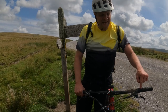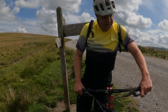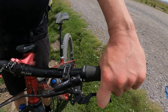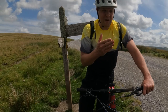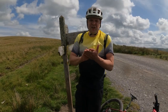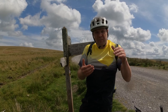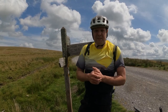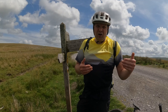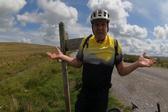Just to compare: my friend Sally's bike runs Shimano Deore XT — a really popular brake that loads of people love. It has loads of free stroke, you can wrap one finger around the lever, and a very definite bite point, but the modulation is very short, so once you're on the brake you need to be quite fine in control. In contrast, SRAM brakes tend not to have such a definitive bite point — some people call it a soggy bite point — but loads of modulation; you can pull the lever right to the bar. On the other side, Hope brakes don't have much free stroke, so they're almost on as soon as you touch them, but then loads of modulation after that. It's all personal preference.